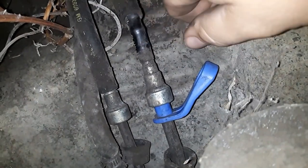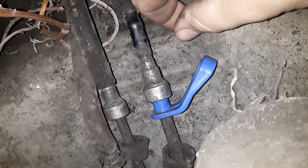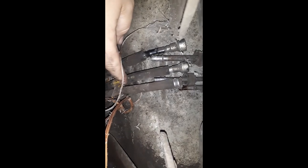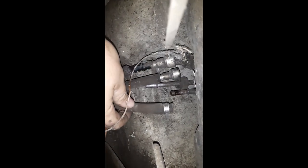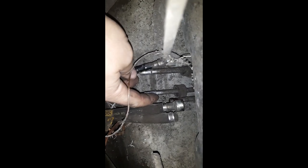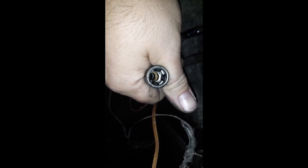You want to make sure you depressurize your fuel line just in case. Chances are if you've been cranking on it, it has no pressure in it anyway. But there's a good bit of pressure — you don't want it spraying down on your face. So we're going to get these taken off. This is your fuel pressure, this is your fuel return — so both of them will probably have fuel in it. This one's your vent. There's what your fuel hoses look like — that was the little rib I was telling you about that the quick connect jumps over. We've got our fuel lines off.